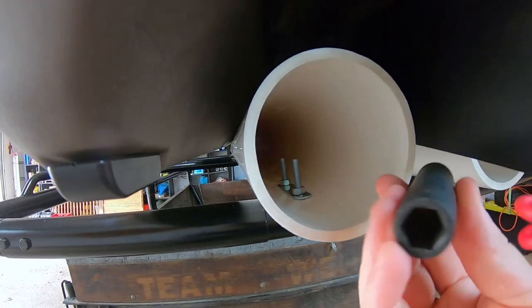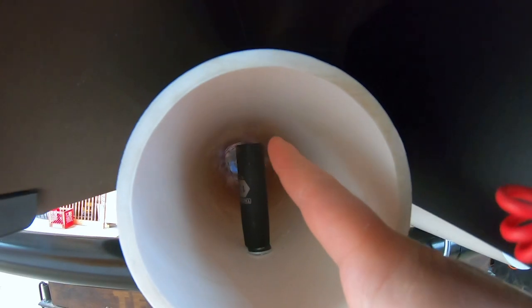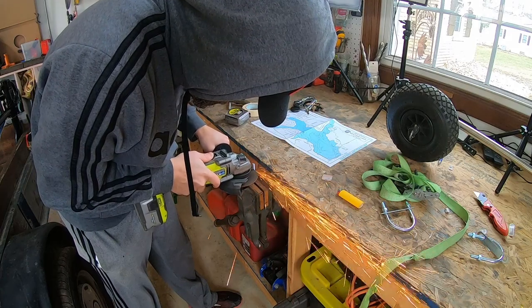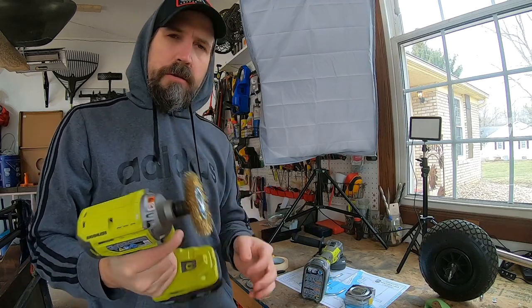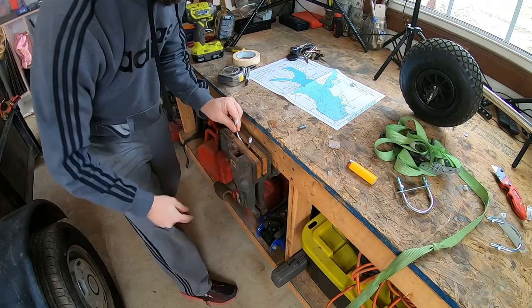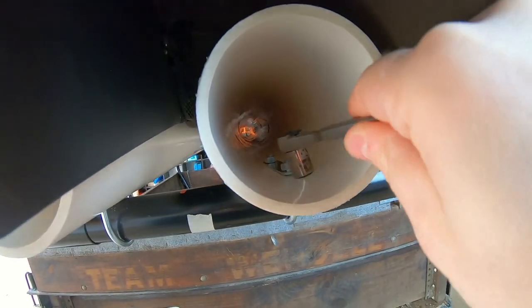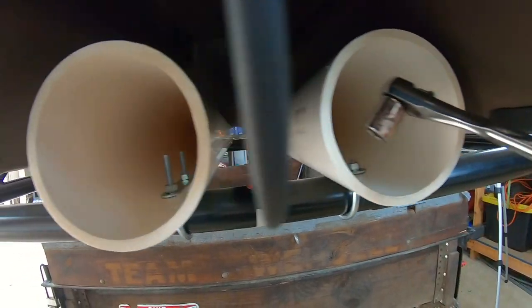This is my deep well socket — although I can get it over top, I can never get my tool up there. After you cut the stems, make sure you take a wire brush and get those burrs off, otherwise you won't get the threading when you try to put the nut on. Now with them cut down, I can get my small socket in and tighten those up.